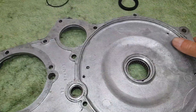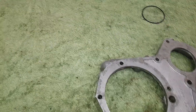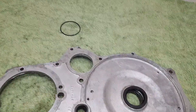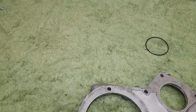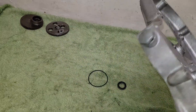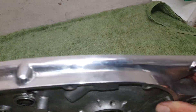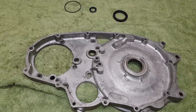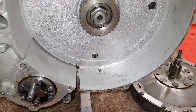What I'm going to do is put the oil seals in - these two facing that way because the oil will be on this side - then put in the o-ring for the oil pump, and put the well seal around and check everything's nice and smooth. Then we'll mount the inner primary chain case on the engine. Note that I did have this polished - just the top edge - because that's the only bit you see, and if it's not polished it stands out from the rest.